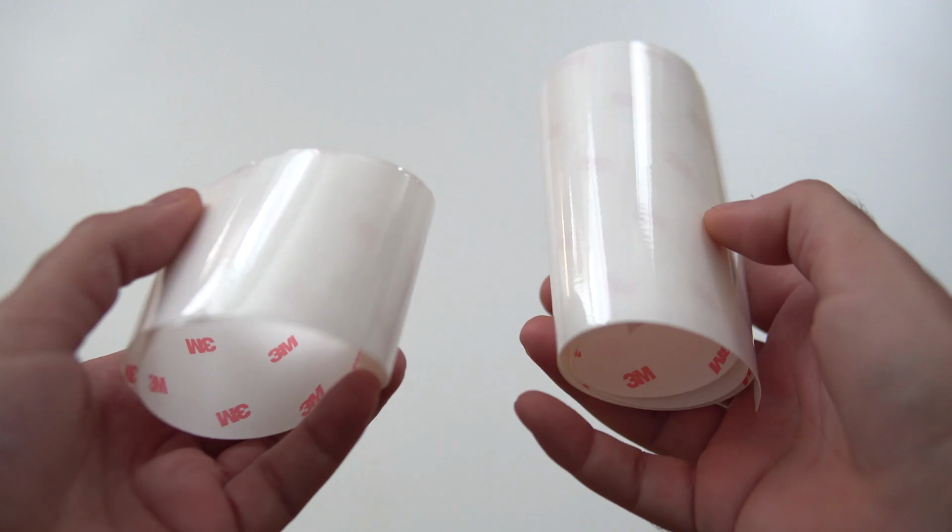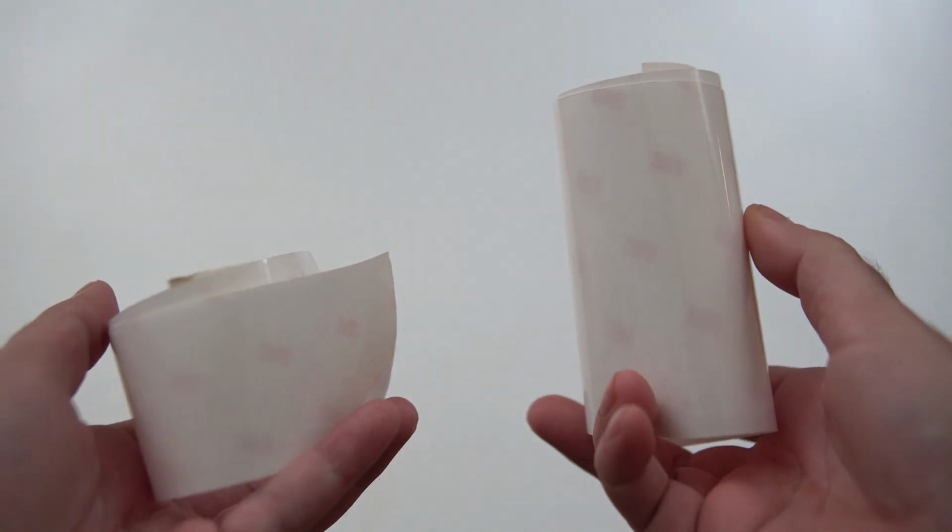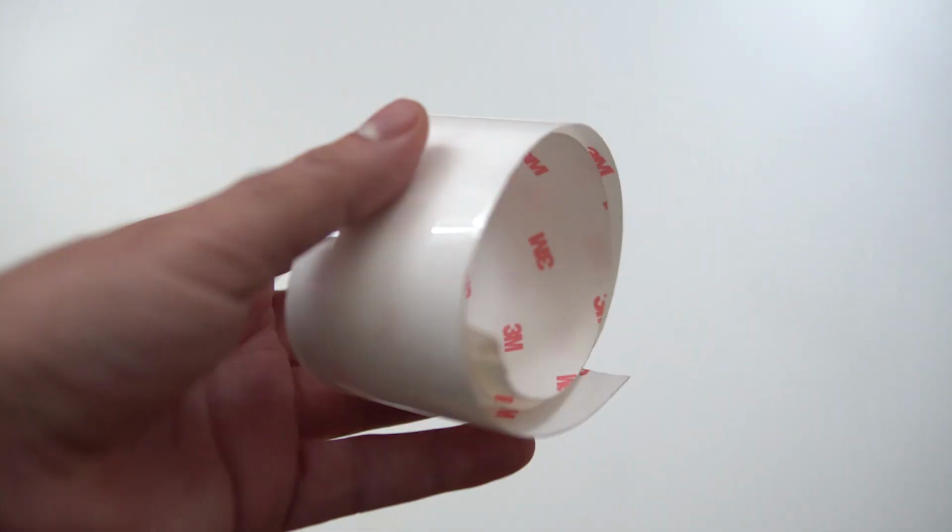Now, for the 3M clear tape that I use, I'll have some links in the description below for the items that I got directly off Amazon, but obviously you can order this from anywhere. I usually recommend getting two different sizes. If you have a modern carbon or aluminum bike, you're going to want one roll of 4-inch and one roll of 2-inch. Now, if you have an older bike or a steel bike that's a lot thinner tubing, you might just need double the amount of the 2-inch. Consider that depending on what style of frame you're putting this on.